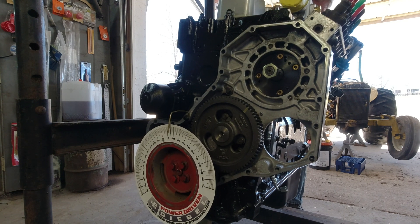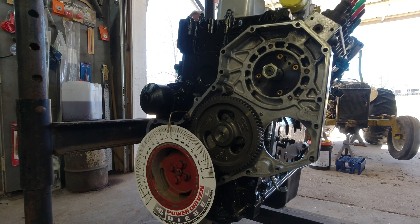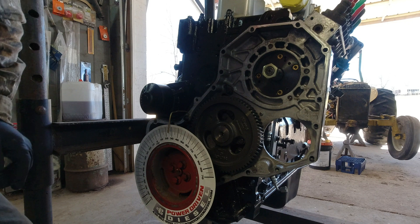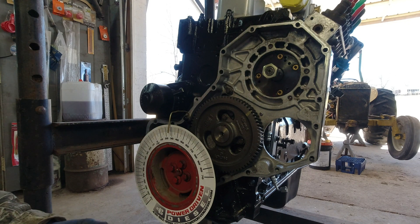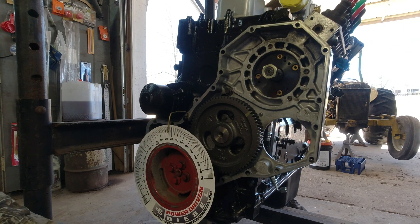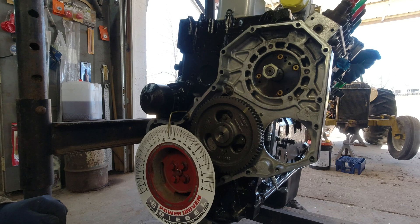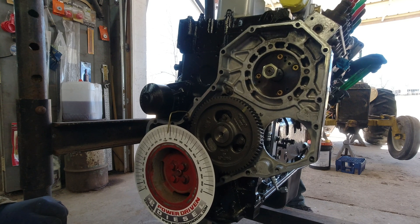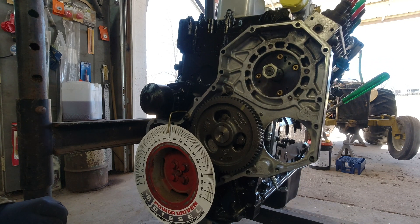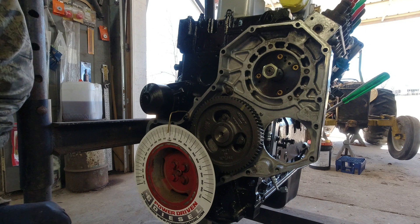That's 10 degrees — which is 20. We'll take it back to 2.5 degrees before we get to zero, turning it real slow so we've taken up all the gear slack. Counting down: 6... that's 2.5 right there. So now we're ready to put our gear onto our P-Pump.